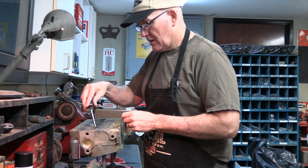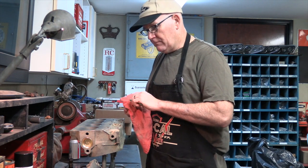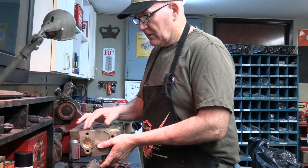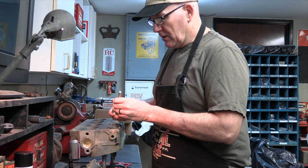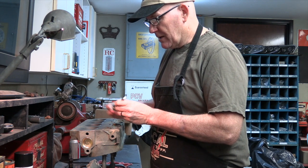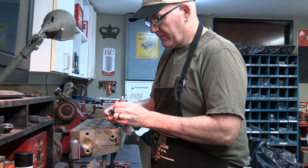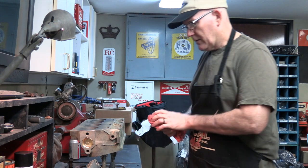I've had heads go back together that after they were vatted and cleaned, the cracks that had been in the cylinder head presented themselves and started leaking. So you hope that because it was a non-leaking, good shape cylinder head before, that you'll be in good shape this time. But you always want to look just to make sure. Okay. All right, that looks good.